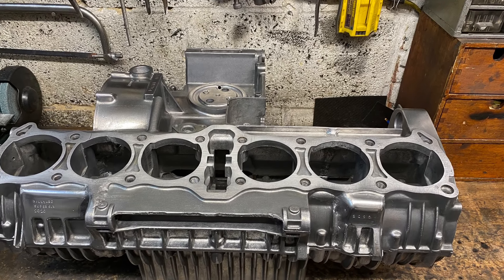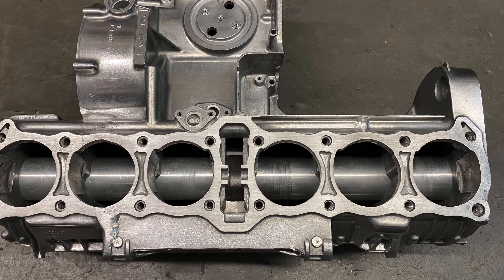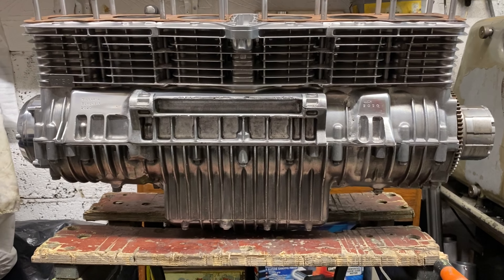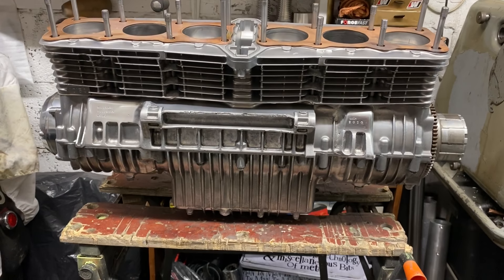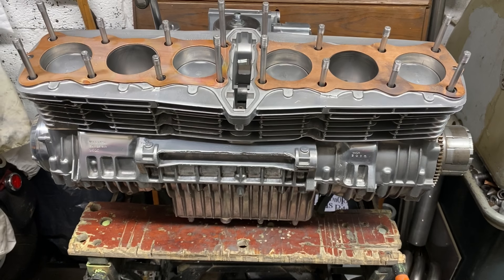I always leave the mandrels bolted in place to the last possible minute to allow the crankcases to stress relieve. And here's my second Super 6 engine, part built with 1,522cc barrels. I hope you enjoyed this video on how I made the crankcases for my Z1 Super 6. I had a bit of luck on eBay the other day — got a couple of cylinder heads off an old Z900. I'll be cutting them up soon, so hopefully in the not too distant future there'll be a video on how I made the head.